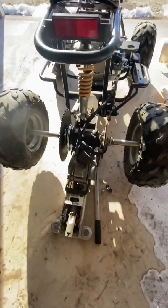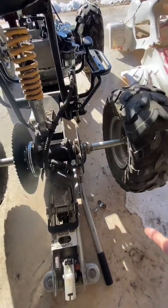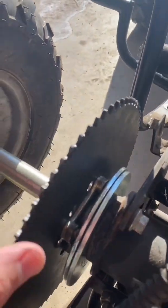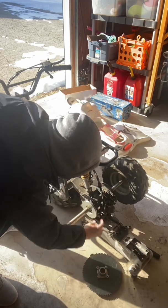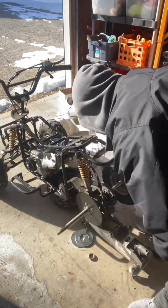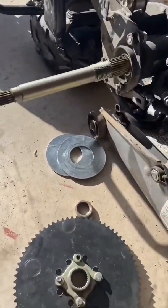One minute of work with my 10mm socket and I took that brake caliper right off. With the rear end up on a jack, I'm hoping I can spin these wheels freely — unfortunately, that's not the case, it's still getting bound up. I'm also wondering what these big washers or spacers are doing. They're very loose, I don't think they belong on there originally, and I know this is not the original sprocket. I don't think they're good. Well, that was great news — whatever the binding was had something to do with the way it was set up with those spacers.